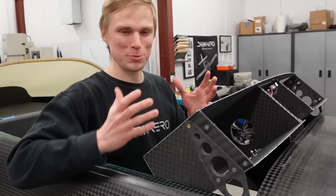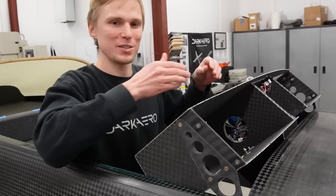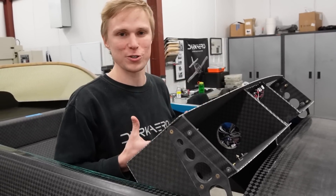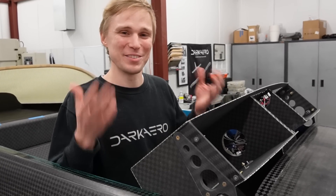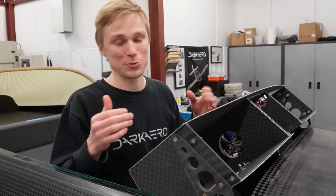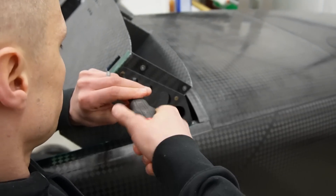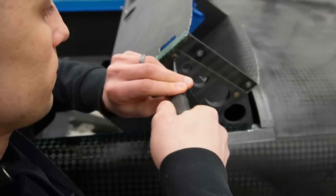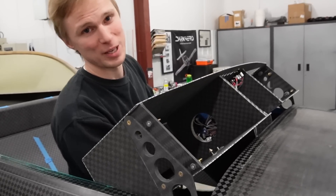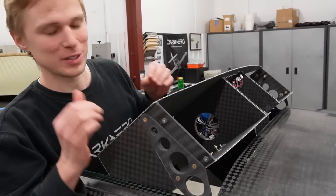Here in the fuselage with the instrument panel propped up, you can see the new hinge design which sits on the outside as opposed to the inside. Previously, the inner hinge design had good ideas — it integrated into the structure of the panel, eliminating parts and weight — but because it was hinging from the center it made the panel wobbly and unstable. By moving the hinges to the outside, we eliminated a lot of this instability. As an added bonus, we gave ourselves better serviceability; the previous design required reaching blindly up inside and took two or three people to install the pins. This design is much more serviceable and less wobbly.